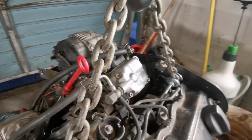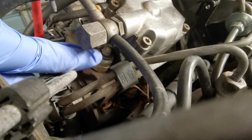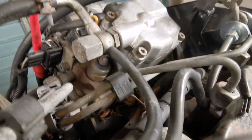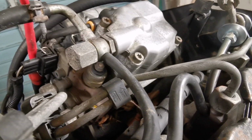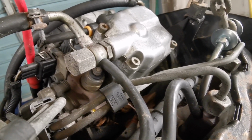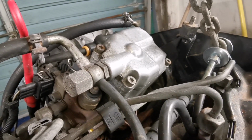I didn't hear much beyond the sound of the solenoid clicking. The solenoid is down there. That's the fuel cut-off solenoid there. Okay, so I heard another click there anyway. So it's disconnected now. Right, let's reconnect it. Okay, so we're not hearing that sound that I was told about.